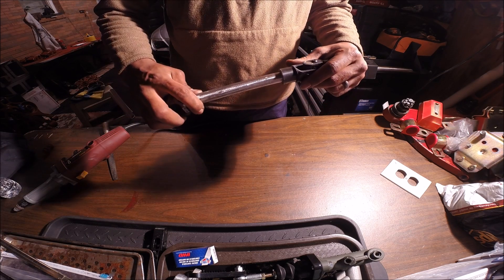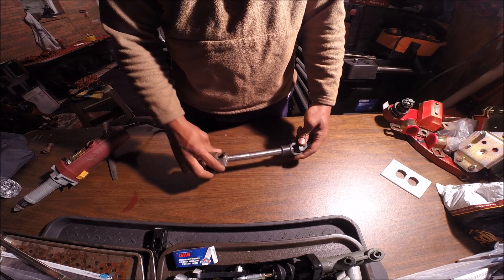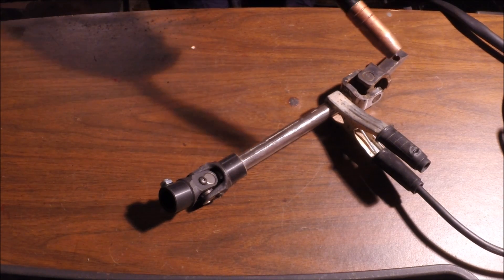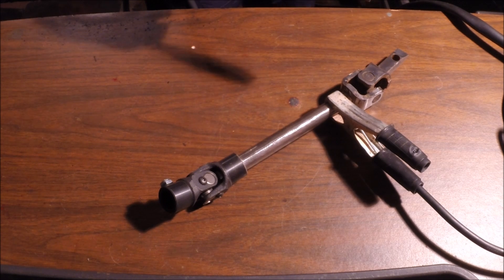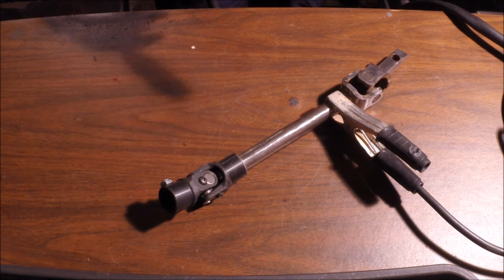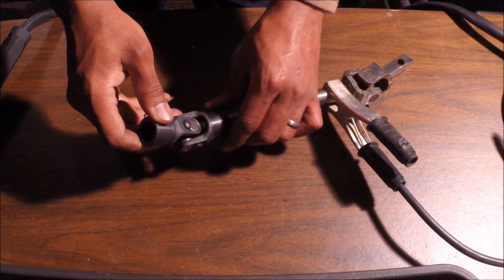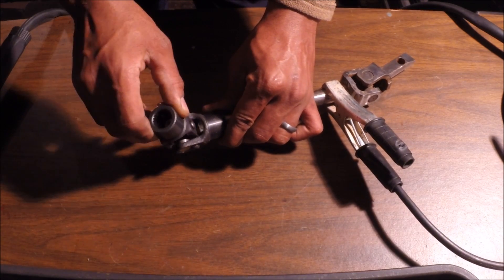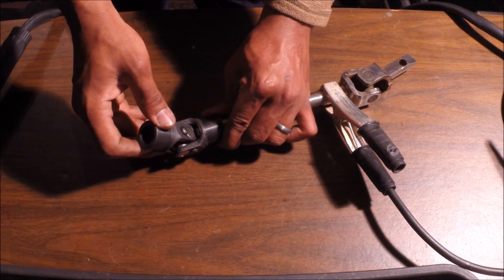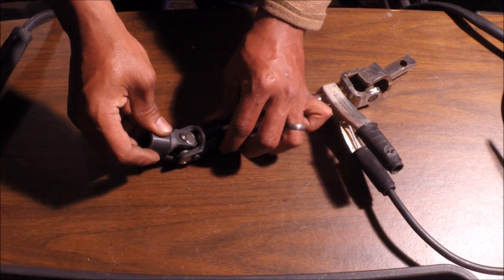Without further ado, let's go ahead and slap these bits together and bust out the dollar store welder. For this job we're going to be using the Harbor Freight Special — the 90-amp flux core welder. If you're looking at doing this type of modification, just go ahead and spend $100 and buy one for yourself — it's definitely going to be worth it. Before you make this permanent, make sure the shaft is not going to interfere with the articulation of the U-joint. Make sure you push it down far enough that it's close, because the U-joint does actually make the shaft slightly longer.